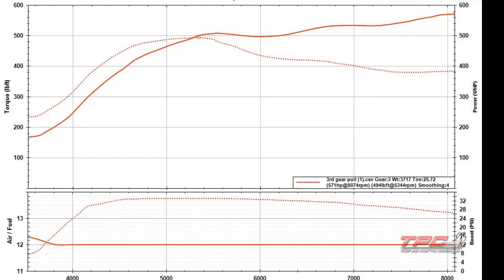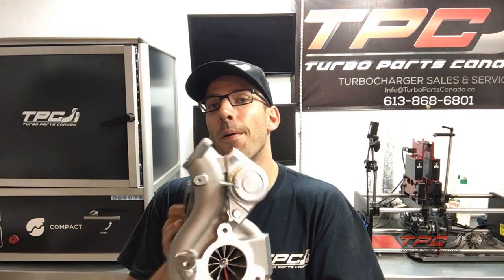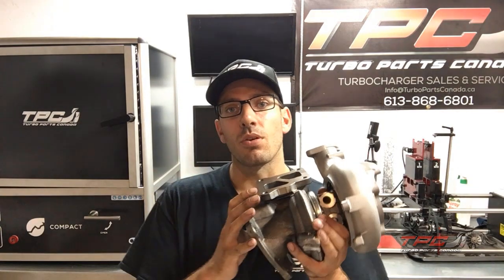We think we'll get to 600 with the upgraded wastegate. You can check out our website to buy the 3576, or send us an email and we'll send you an invoice. We can port it, ceramic coat it, and it comes with upgraded thrust components. It holds 30 psi pretty solid, spools around 4250-4300 RPM — a wicked street turbo and wicked top-end all around. Guys are always shocked how fast a big turbo like this spools with the twin-scroll housing.